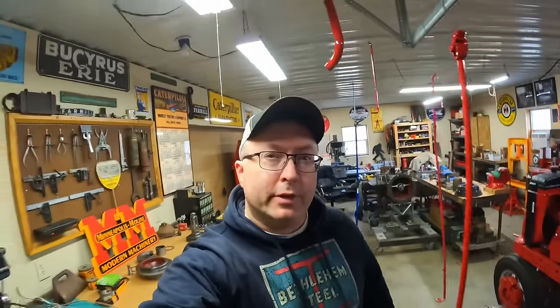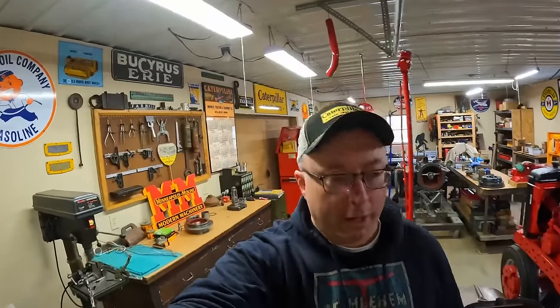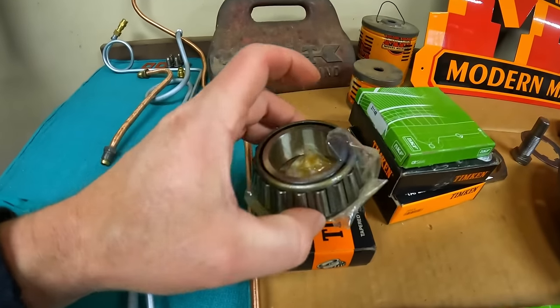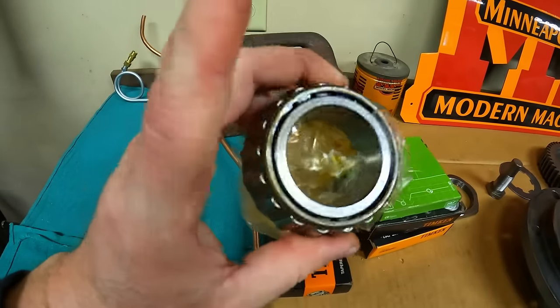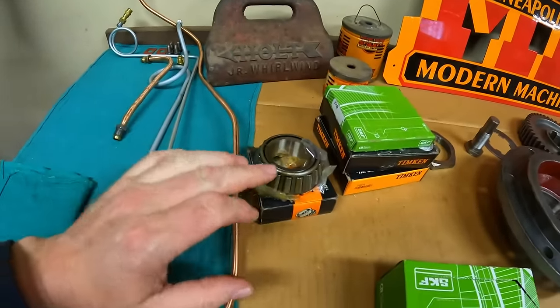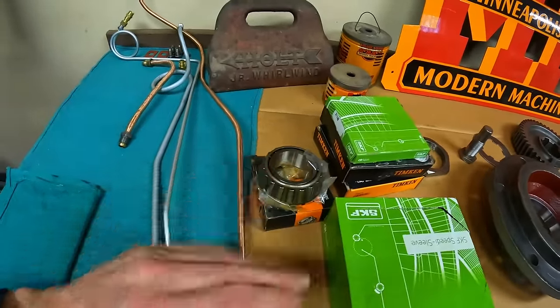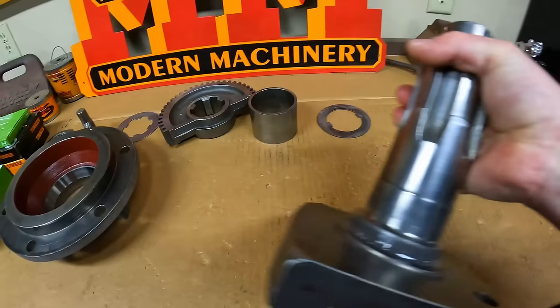Welcome back to the X231 series. Here's the piece we've been waiting on — I had to make sure it was positioned upright so you could read the speedy sleeve for the vertical shaft. This was the delay. We also had one of the new old stock Timkens that we found on eBay show up. I took it out of the package enough to make sure it looked good; it's still covered in some sticky cosmoline, which we like. We're just waiting on the two races I bought to go with it, but we don't need those now — we can wait until the bolster comes back.